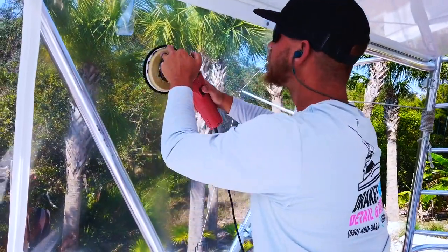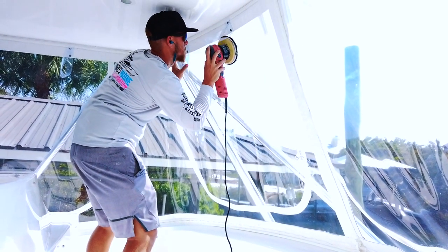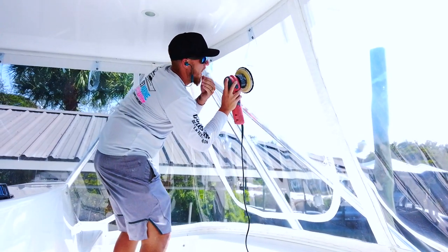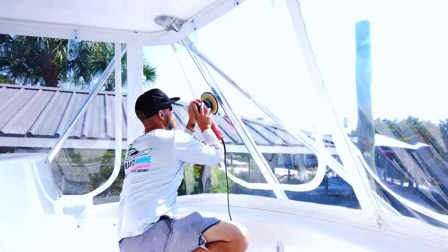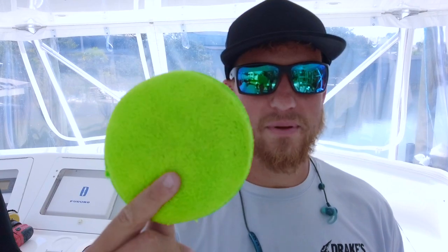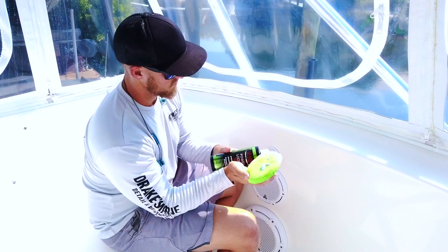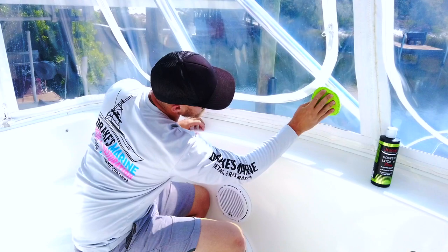You do this a little differently. When I buffed with the DA, I buffed the Isinglass going side to side and up and down. Now we're going to leave it sit on there for 30 minutes. Do not take a rag and wipe it off instantly — you're going to kill the effect of what it's trying to do. Right now it's going to fill in all the pores, sit on the surface, then dry to a perfectly dry finish and buff off super easy. For smaller areas where you can't get the machine in, get a basic applicator pad and do it by hand. Just put a couple of drops on there and wipe it on real smooth — you want to see the product actually stay on there.